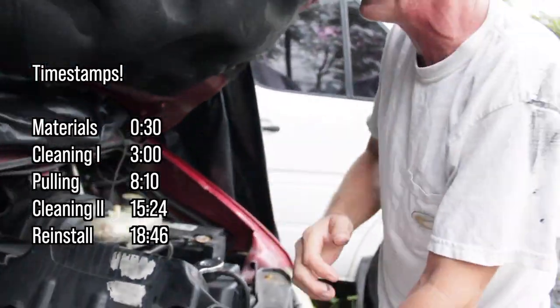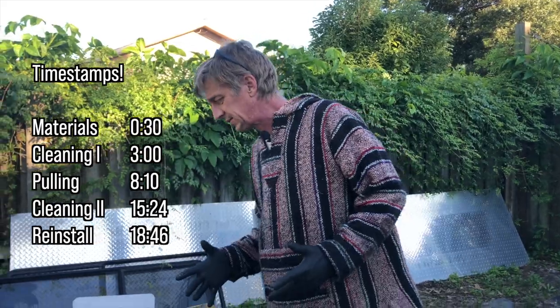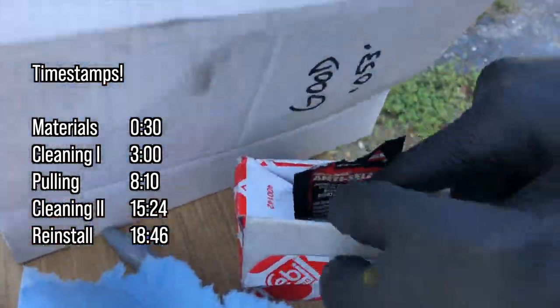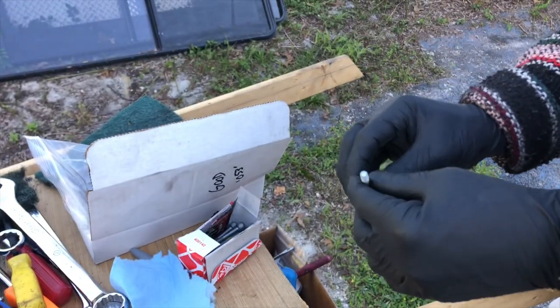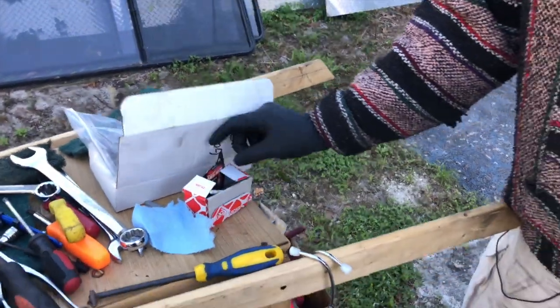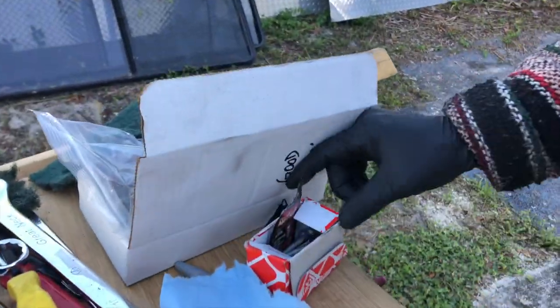That's a popular video. Three weeks later, a couple of absolute must-haves: new hold-down bolts and seals and injector seals. Pull that one back out. Never reuse a seal. Should never reuse a bolt either — can't say I've never done it, but it's not a good idea. Anti-seize is an absolute must — some kind of grease, anti-seize, in there so the injectors come out next time you need them to come out.